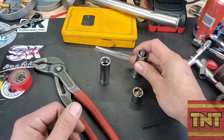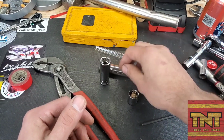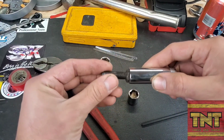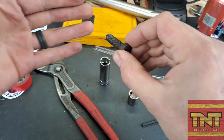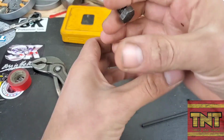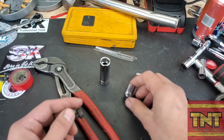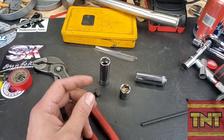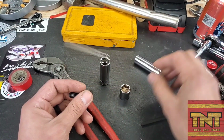like a pecker head on a large motor, which is just an example I've experienced several times, and you need every bit of that bolt to be outside. You need it like that so you can push the bolt, the pecker head and the gasket, push it all into place. The seal tight on top will kind of keep it pulled out, right? So let's get back in focus here. That's really going to mess you up.